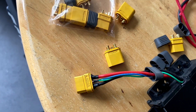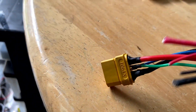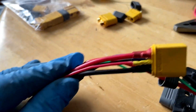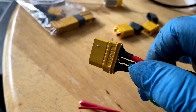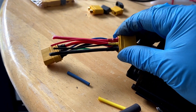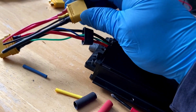I've made this little female plug — basically this will go into the other battery, and this one I will wire into the system board. So I've got one battery with a plug coming out for the other battery to plug in, and then this one will be plugged into the system board. I'm going to finish off this plug — I have to do this four times. We've got two big batteries and two small batteries at the back, so I will make four of these and solder them all onto the spare batteries I bought.